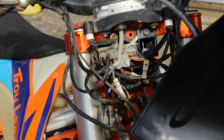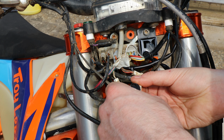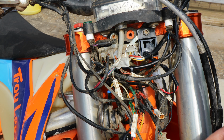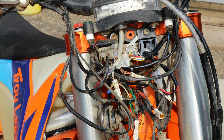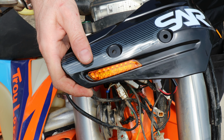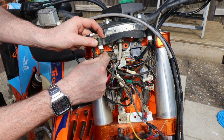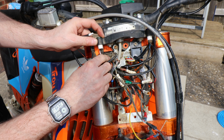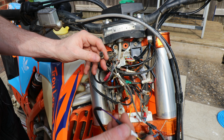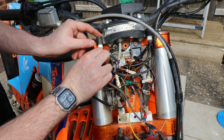There is a lot of crap in there. That should be the other side, I think, given the writing, but we'll give it a go. One flashing indicator. Right, so first things first, that's the fuel injection light. So pull the front one out, which is this one. We take that out and we pull the bulb. That's it, bulb out. We take this and put this into where the bulb went. This then pops up into there.